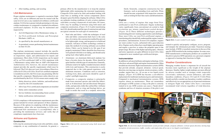The FAA does not issue airworthiness directives (ADs) for SLSAs or ELSAs. If an FAA-certified component is installed on an LSA, the FAA issues any pertaining ADs for that specific component. Manufacturer safety directives are not distributed by the FAA; SLSA owners must comply with safety directives, alerts, bulletins, and notifications issued by the LSA manufacturer. These include: ADs if FAA-certificated components are installed; safety alerts requiring immediate action; service bulletins recommending future action; and safety notifications that are informational. Pilots transitioning to LSAs must understand how maintenance is accomplished and verify that all compliance requirements have been met.